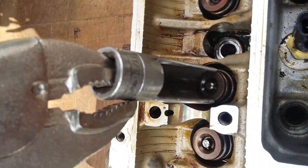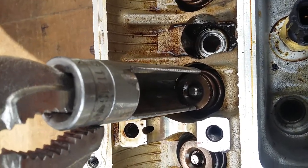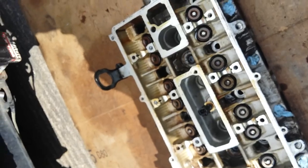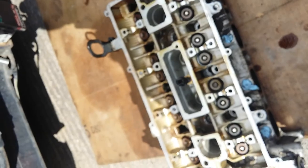I lapped the valve, put the new one in, pushed down gently and kind of rolled it around until the keys fell into place, then let it up. A conventional valve spring compressor won't work here, so I made this tool. Now I'm just putting it back together.